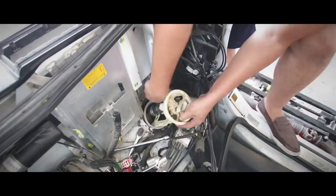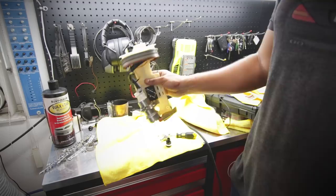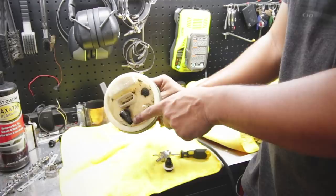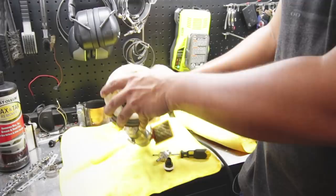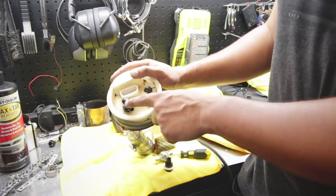Here is the assembly for the fuel pump and fuel level sender. It's identical left to right, but this is our culprit. When I had the car in the on position with the fuel pump running, I saw fuel collecting right here in this little bowl. That means there are probably no cracks in the housing itself — it doesn't look like it — but there is a leak when it gets pressurized, so it's either the feed line or the return line.